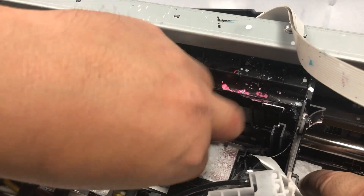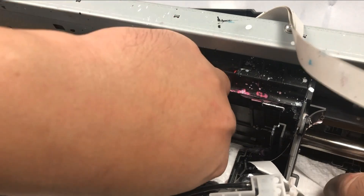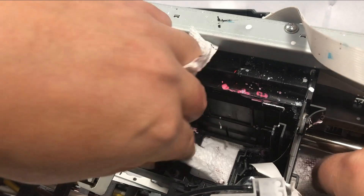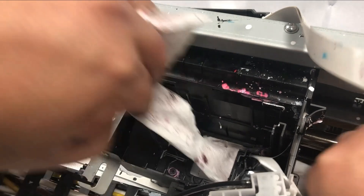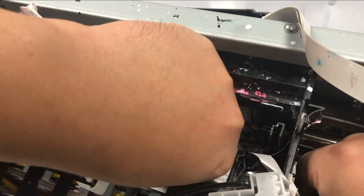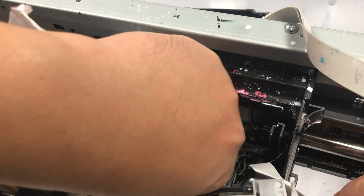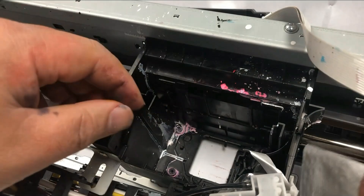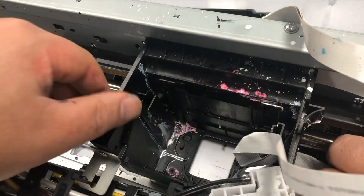When you print, the ink gradually accumulates on the bottom and dries there, forming a thick layer. When the layer is thick enough, if you have a profile like rip boost — which I really like — rip boost puts more ink than the regular drivers. This is why when you use rip boost, the height of the ink layer can get scratched. But if you switch to the regular profile, it's a little bit thinner and doesn't get scratched.